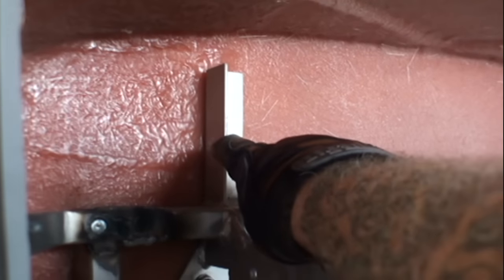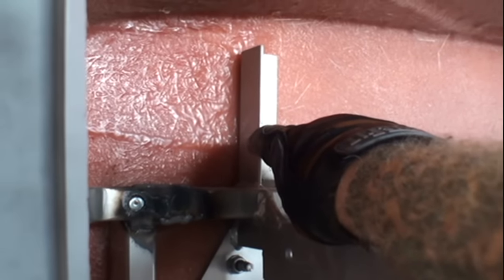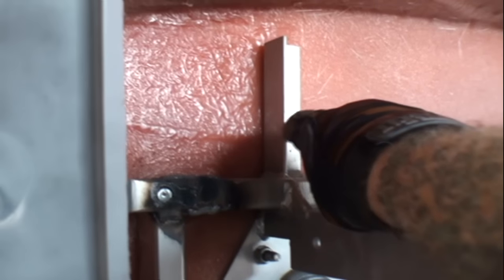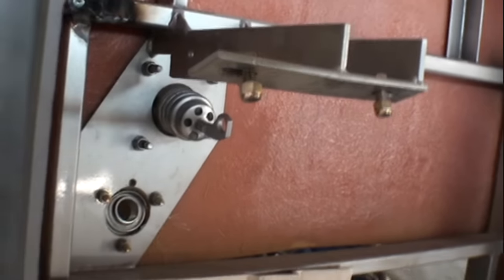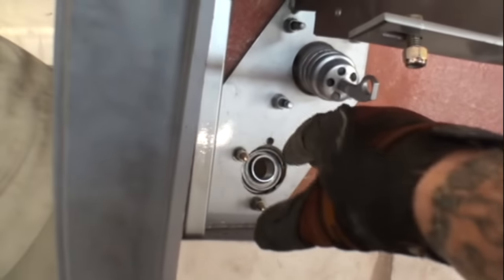And then once we get the floor in, we gotta finish out the inside of the firewall by adding a 1x1 or a 1x2 bar so we can mount all of our electrical accessories on that. And then we gotta weld some quarter inch lugs, studs or bolts, onto that bar so we can have a ground area where we can start grounding off our electrical system. We still gotta put our air conditioning unit in. We gotta get TW to get that steering column back in once he gets done with all the welding.